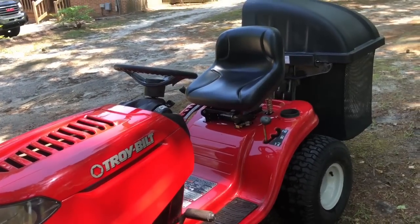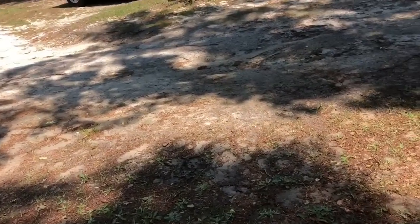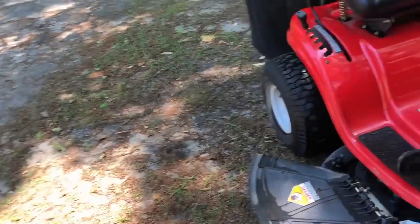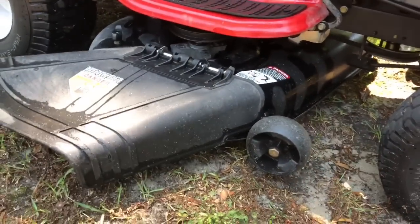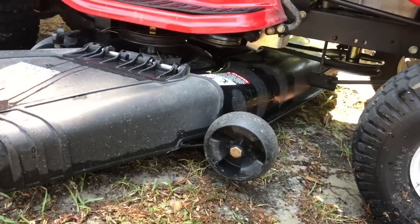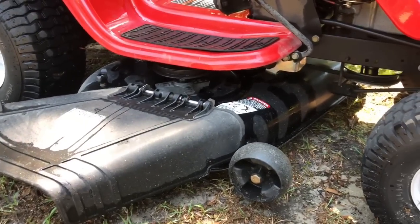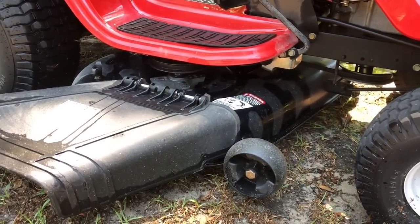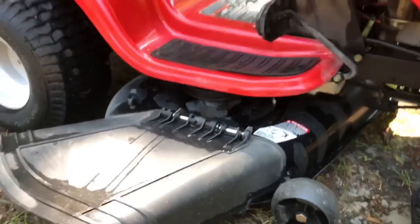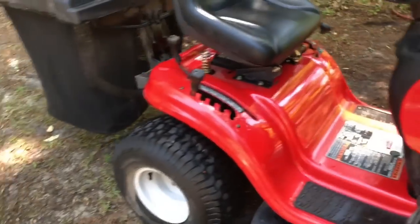Just kind of roll that pulley and put that belt on at the same time, and you can do it by hand. Or you can loosen the bolt and the whole thing will wobble, and you can move it to get it on. But when you take those pulleys off, make sure you put everything back in alignment or it'll come right off. The spring on this is automatic. There's a return spring on the very back. It came off, and I had to put that back on.